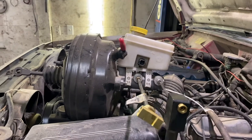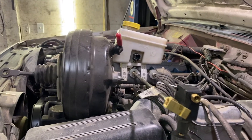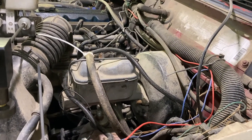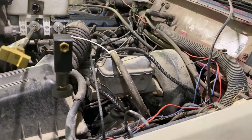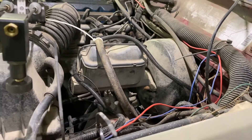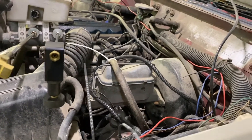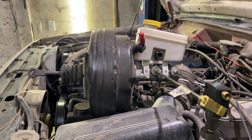As I stated in one of the other videos, we've got issues with this old 92 XJ — that's Cherokee for the non-Jeeping type folk — running JK disc brakes from this master booster and prop valve, because this was designed for much smaller brakes and drum in the back, not disc. So she doesn't like to stop very well. So what we're going to do is upgrade to the JK master booster.